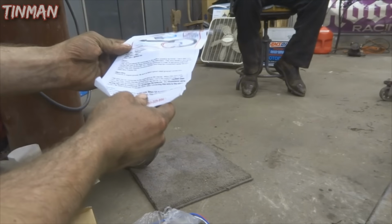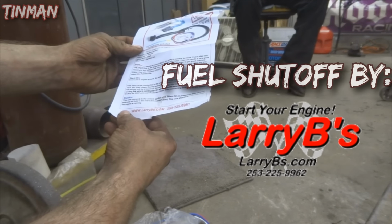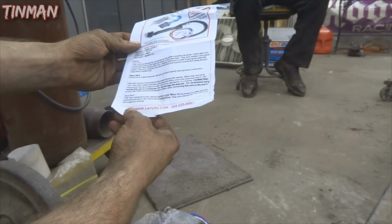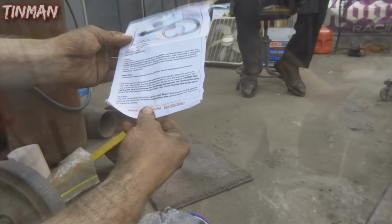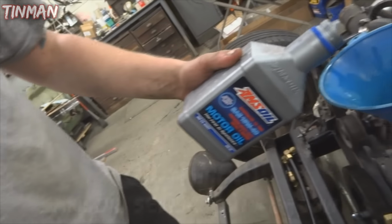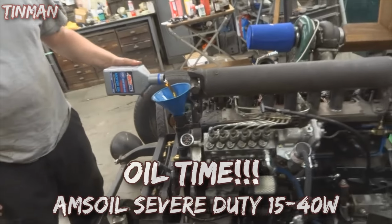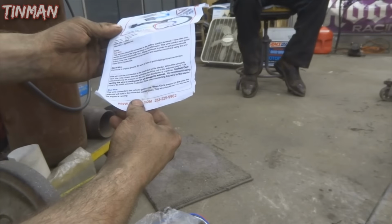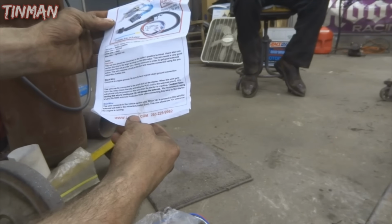Three wire, right? Red wire should be connected to the battery positive. Black wire is ground. White wire, small stud on starter. Blue wire connects to the vehicle ignition. Okay. So we have to hook the blue and the red to a battery pack and just ground the black. So all it does, I think, is when the white one hits, that turns the solenoid on just to pull it up, and then the other wire energizes the magnet to hold it up.